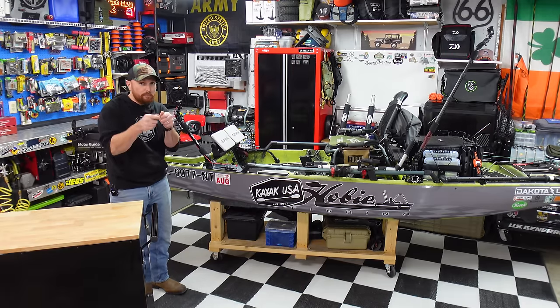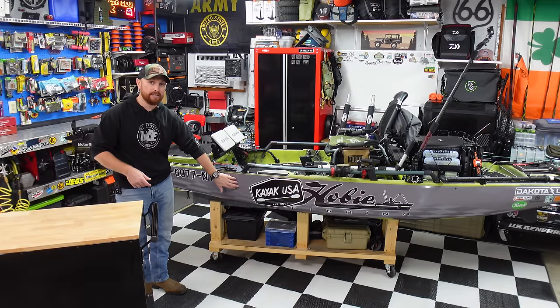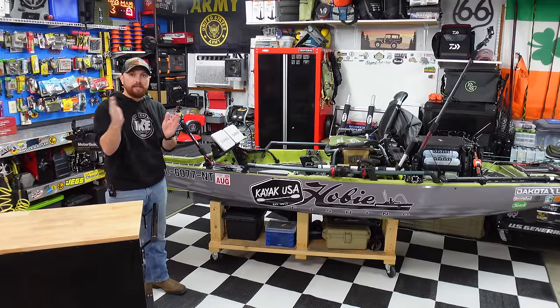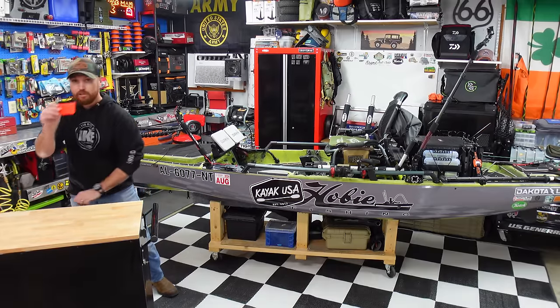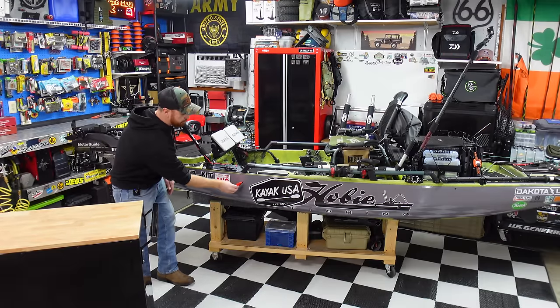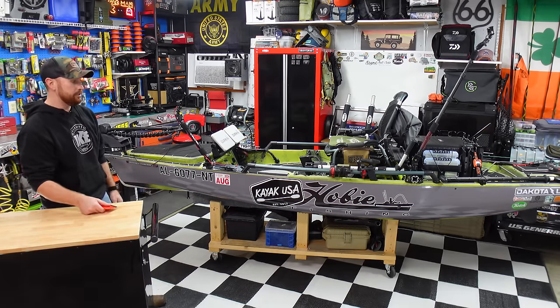If you can work a bubble in one spot, you can just make it disappear right there where it's at. What I suggest is if you get to a place where you've got a big air bubble, split it in half with your little squeegee. You get this with the wrap too. It's got a little felt end on it. Just cut the bubble in half with your squeegee, and then you can work it, and that bubble will disappear. You just gotta be patient and take your time.